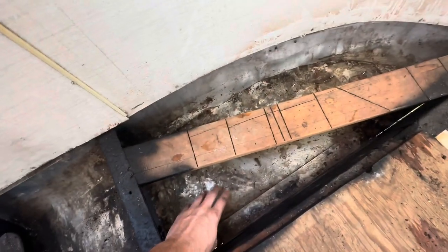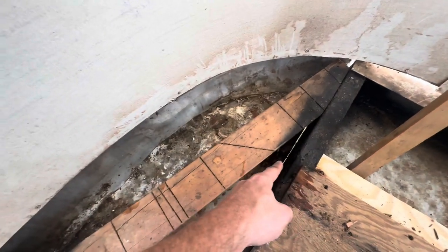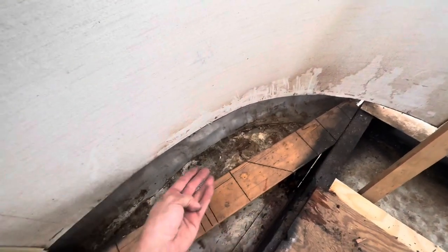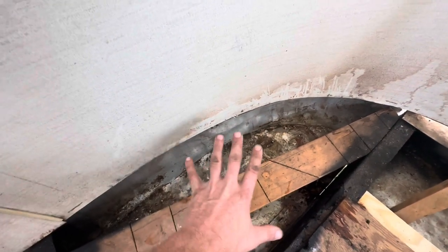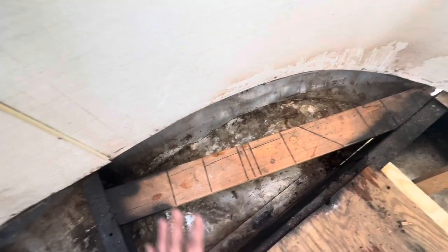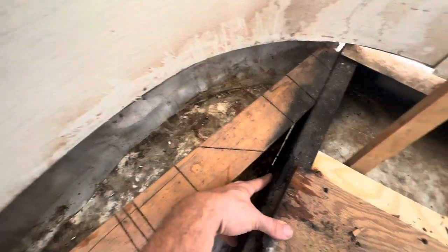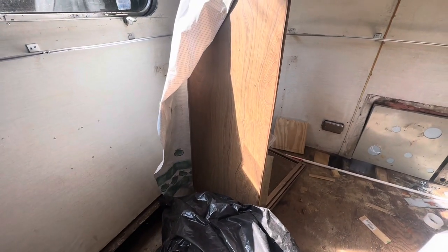This here is the outer skin of the camper - just outside this thin piece of metal is outdoors, and you can see some of it coming through the cracks. This is the tail end of the camper and at some point it got slammed onto something, so all this was dented. I'm utilizing modified truss screws to help pull the metal back into place, then I'll clean this up and add spray foam along all of these seams, and then seal it from outside with a sealant. I've got to crawl around underneath this morning but it's all gonna be worth it.